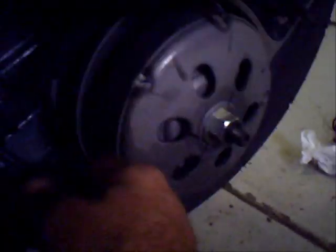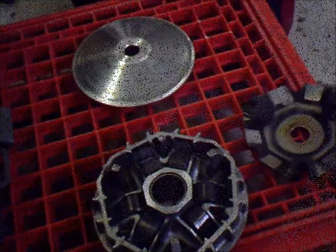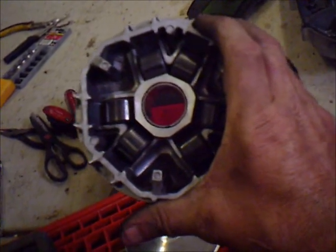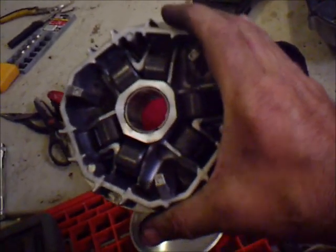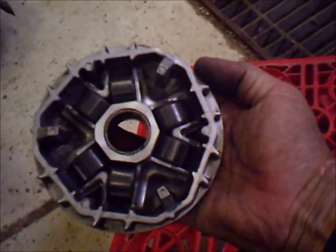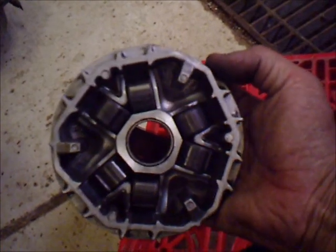Right now I've got to get that belt off. That means I've got to take this clutch off, slide this whole assembly out, and change that belt. Because I don't know if you can see it — it's awful tight up in there. So that's what I'll work on right now. You know folks, now that I think about it, I'm not overly thrilled with that variator. Looks like it should tear the engine apart. I'm not real thrilled with that.